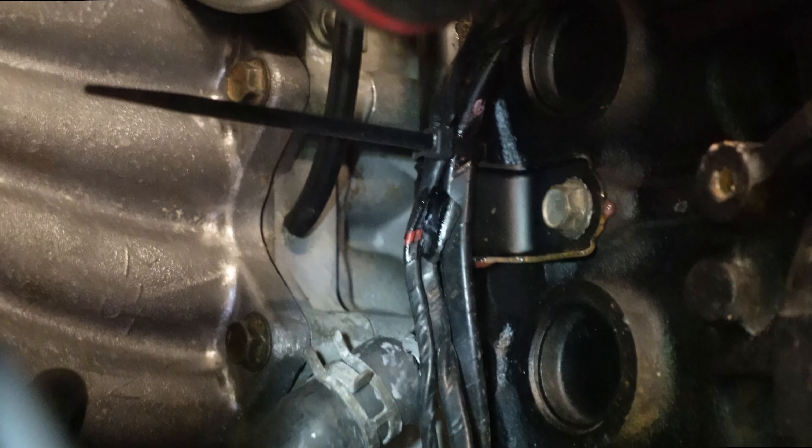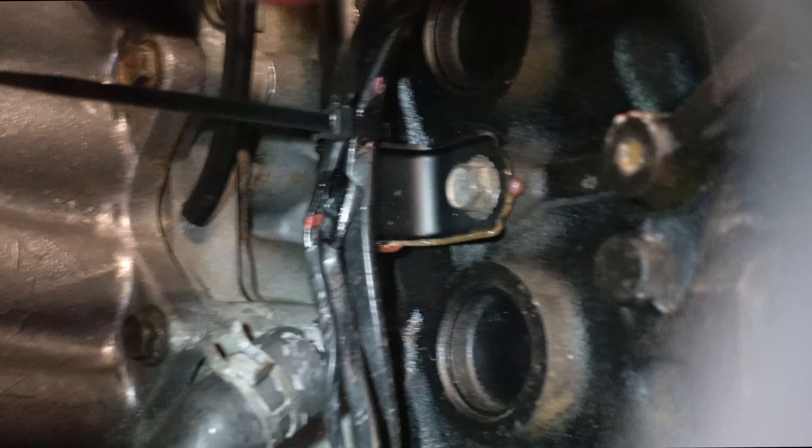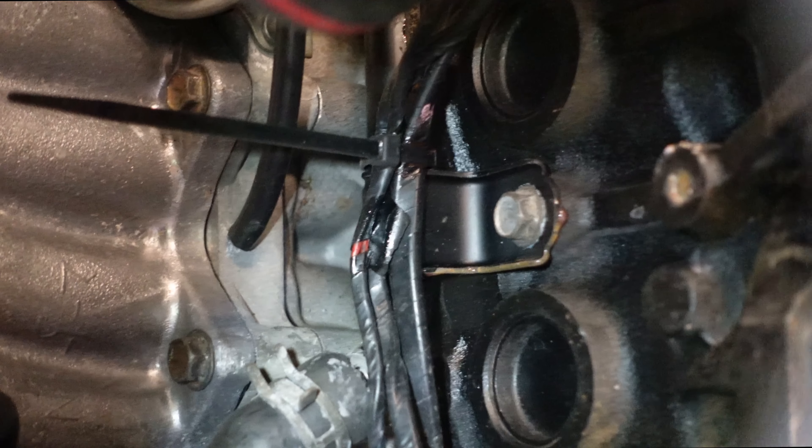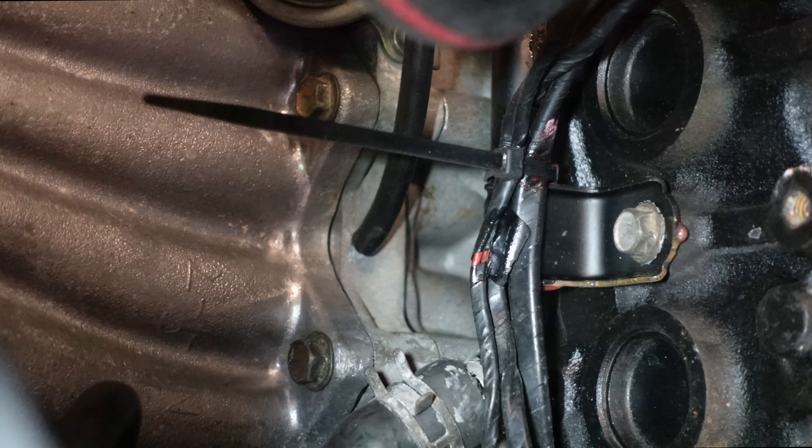Anyway, let's get to this coolant leak. Tracking it down — this is the bell housing of the transmission, and I don't know what transmission this is, so if anyone knows how to identify Toyota transmissions let me know. It's coming up from there... I've spotted it. There is a drip coming from a little bit higher up — that might actually be the head. If that is the case, I'm going to be really pissed off, because that might be why it's running lumpy. I need to go from the top and figure it out.